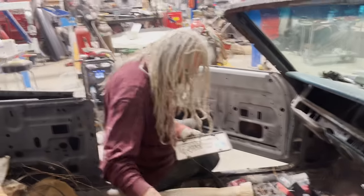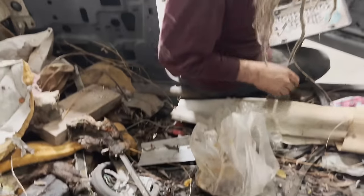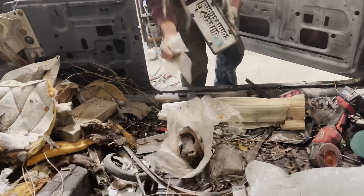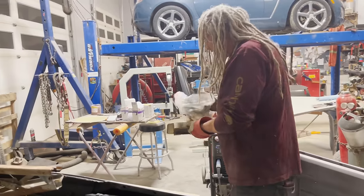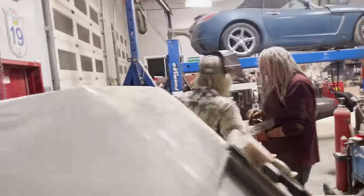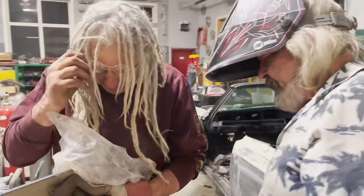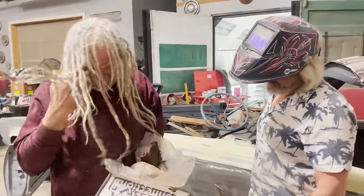What's this? Hey, I got to check the option list on this car, because that is a single disc brake caliper. It was 68 only. This could have been a disc brake car, Blair. Oh, no. Because they had that one year only funky. Yeah, but that's hard to get. I know, but is that what the other one looked like when you took it? The one year only was single piston. Yeah, but there's a special bracket in the top. Anyway, we'll put it up there just in case.